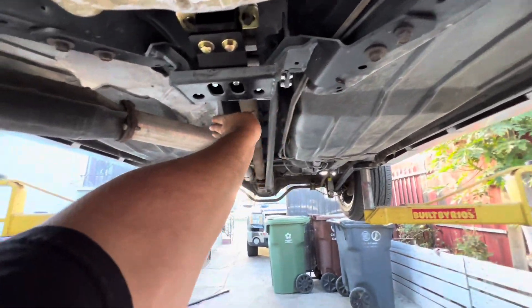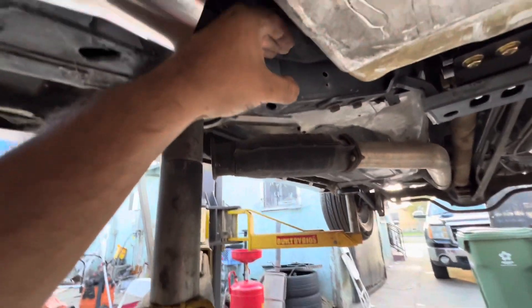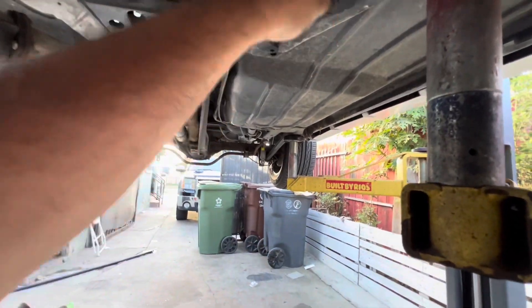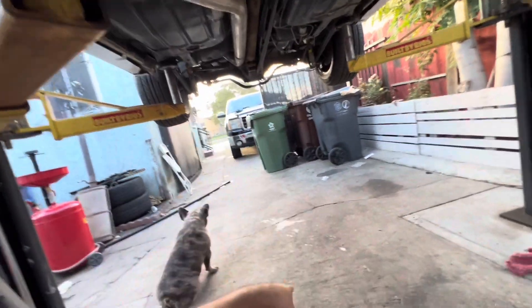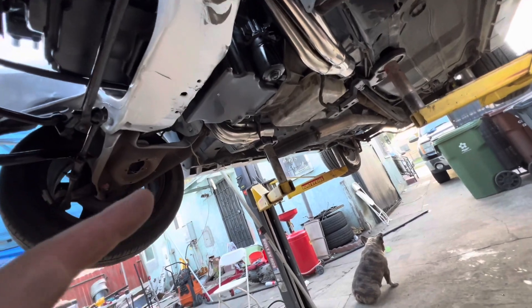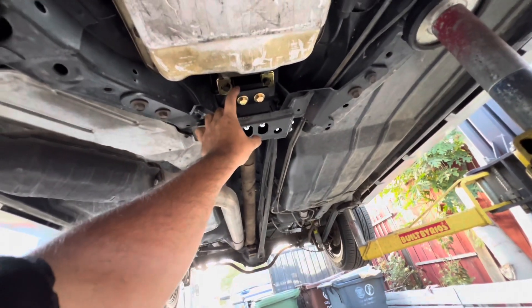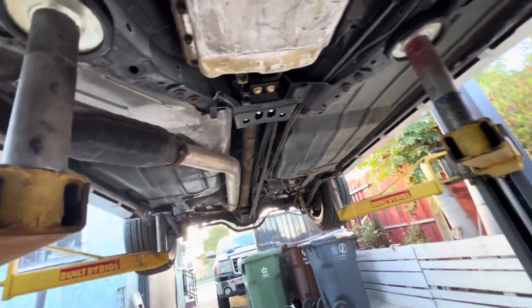The exhaust goes through here and merges into a pipe. The other cross member is a solid pipe — with Speed Engineering you'd have to go from here, down and out, and you'd have clearance issues on the floor if you have a drop. That's the problem with other cross members. With this one, if he goes with a T56 I just change this center piece; a 4L80, you change this piece; a 6L80, you change this piece. You don't have to change the whole cross member — just this center piece, and it's like 30 to 40 bucks for each different transmission.